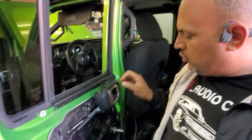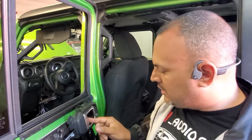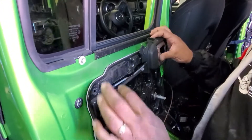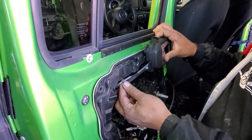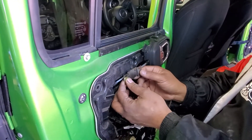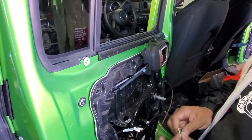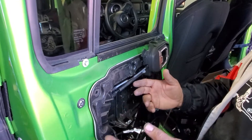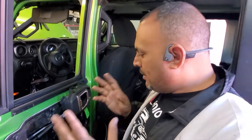Six and a half hours later — now that we got the grill done, we're getting the power door locks done. Drew already removed the door panel. These cars are actually more involved than people think. You see this mechanism here — it's driven by wires. When you put force on it, the wire moves everywhere and doesn't do anything, but when I hold it in place it starts to work. I have to insert a bracket to hold the wire in place so when I add my actuator, everything works properly. I'm cutting a little bit of plastic here to make a flat foundation.